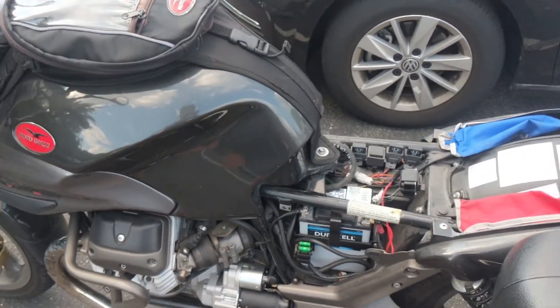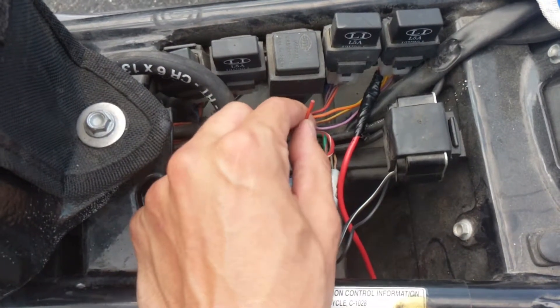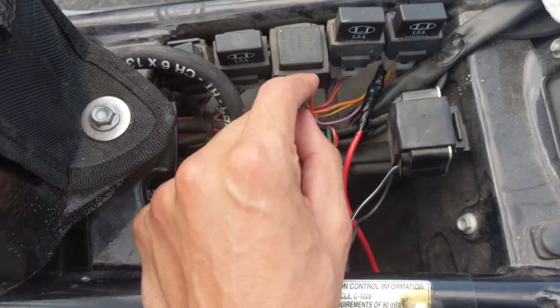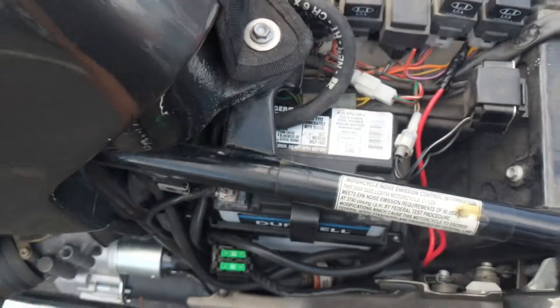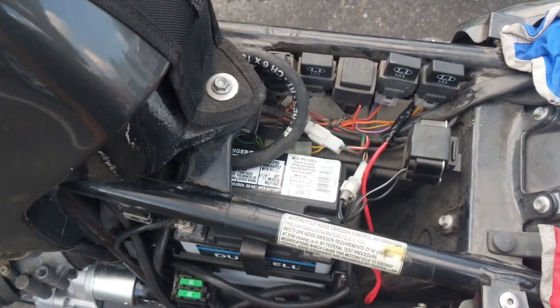Thanks for watching. I hope this can help you guys too. Just a quick little hint: the other end of this wire that I'm going to tape off, you could also use as the hot wire for a switched accessory — just put the hot wire here and then ground it somewhere, and that will be a switched-on accessory. I'm just going to tape it off, but you have that option.